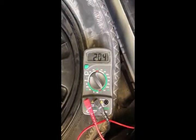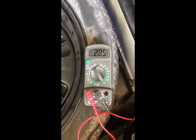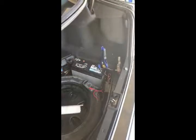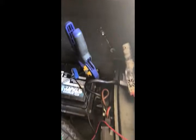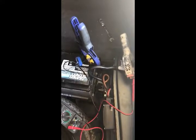Right now I'm drawing about 2 amps from my power seat even though the car is off. This will drain my car in about 2 days. I have closed all the doors per the other YouTube videos, made sure the car is asleep, and connected everything in a way that allows the multimeter to be in series with the negative side of the battery cable.